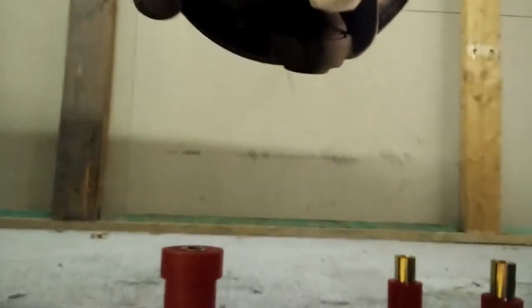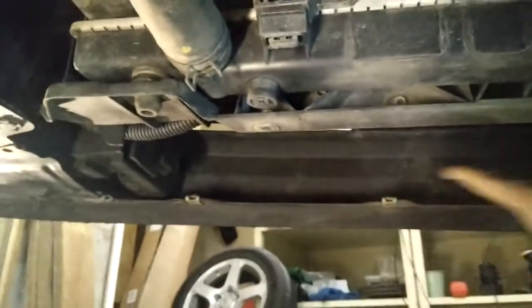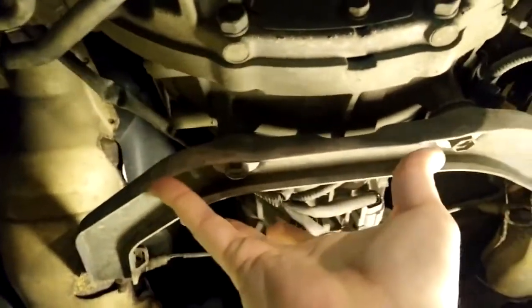To start off, obviously I got the car jacked up. I took off the wheel, and then the next step is I took off all of the underbody molding with 10 millimeter bolts that held it into all the attachment points. I took off the front piece that sits right here and I also took off a smaller plastic shroud that fits back here underneath the transmission.